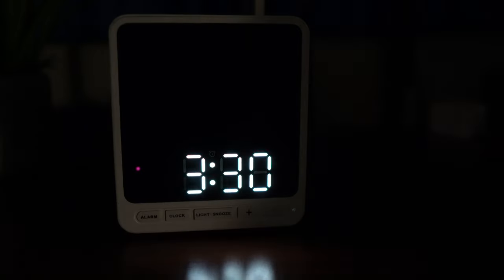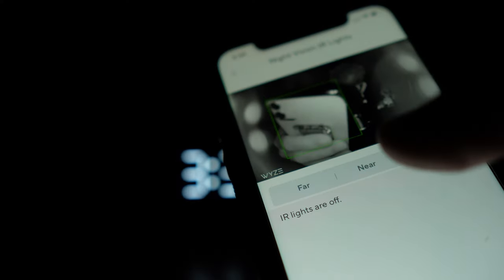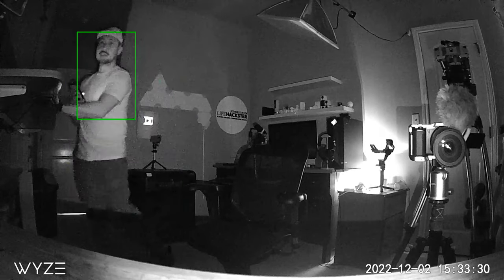I'll turn off the lights to show you the night vision mode. You can see the camera's infrareds are on, and on the camera's view you will see the infrared glare — that's the reason why we need to turn it off. If not, you will have unusable footage. When it is off and it just uses the clock's infrared light, we now have a clear, crisp image. So make sure to turn off the status light and the camera's infrared LEDs, and just keep the night vision to auto.